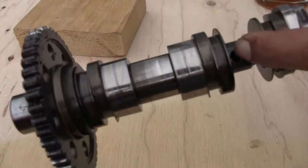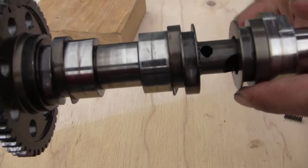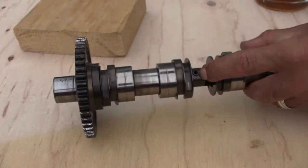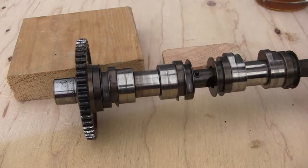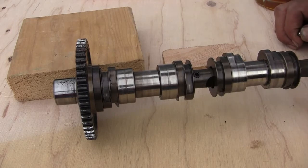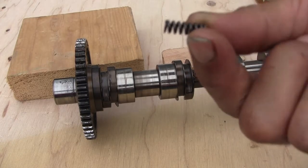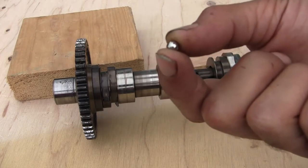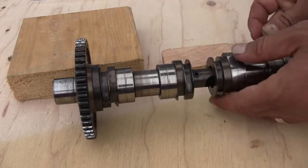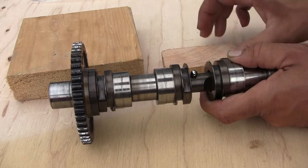Here's how to fix it — it's actually easy. You have to put this piece inside, and then you need the stopper. Luckily you can call Audi and order these parts. Just so you know, this little spring costs $23, and this other piece is about a dollar fifty or sixty. To install it, you place the ball just like that and you'll need a small piece of wood.